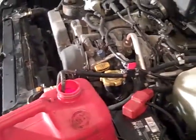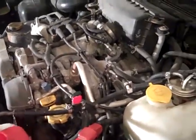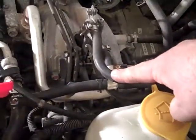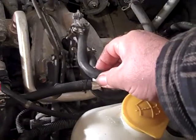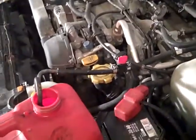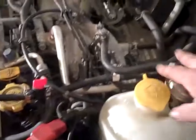Yeah, I would definitely say it takes two minutes or so to fill a gallon of gas. One thing you don't want to do is tap into your fuel line itself, because then you'll have low pressure going into your injectors and you'll have an issue with it. You could, but it's going to be a problem. Go with the return line — a lot better. Some return lines are made of steel and some are really hard to get to, or in the back of the motor and stuff. But this one is real easy, and they should put this on every car.